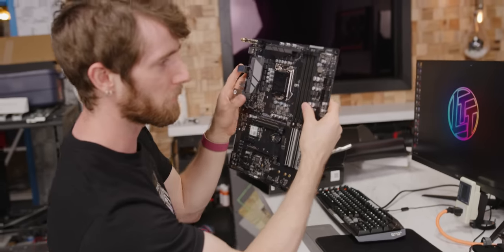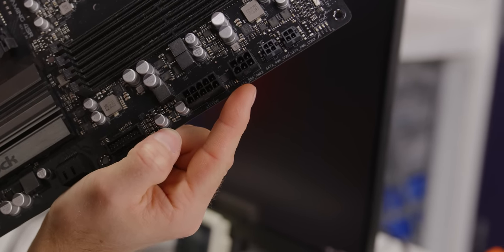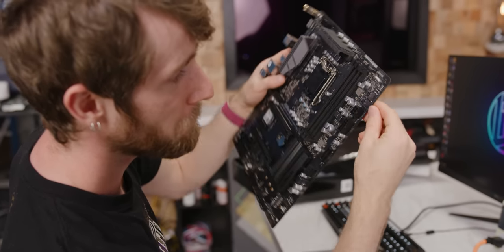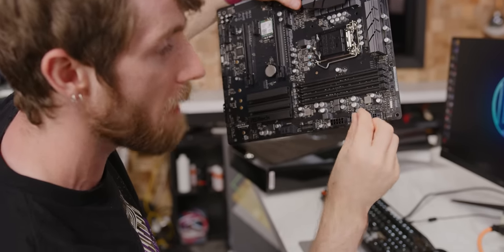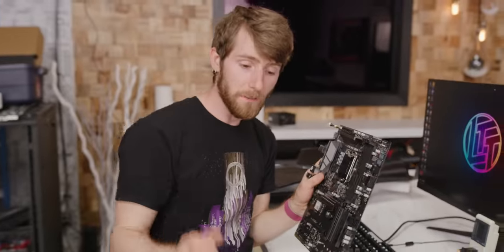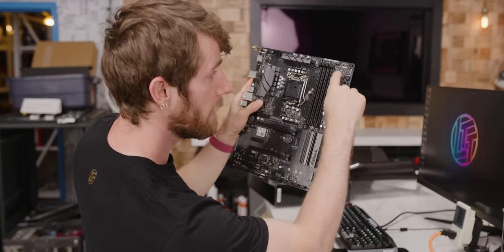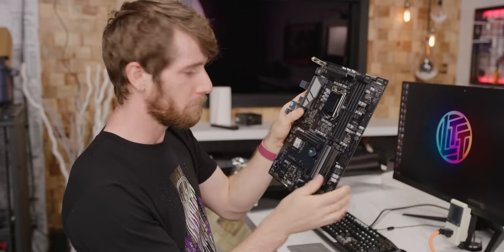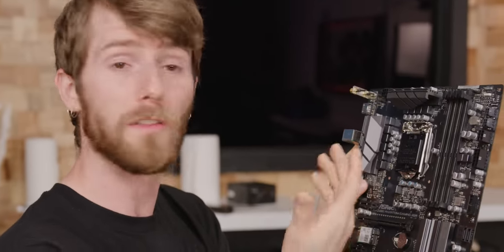But up here, this is where things get spicy. That's where that 10-pin connector goes — this is called the ATX 12VO connector. And then that second six-pin, which is otherwise identical to PCI Express six-pin, is apparently called ATX Board Power 2. These are fascinating: just like we saw on the Mac Pro where if you wanted to plug in a SATA drive you actually had to plug off of the motherboard to deliver power to it — we're seeing exactly the same thing here. These are SATA power connectors one and two. Remember, the SATA power connector on the power supply doesn't have all the conductors. So we actually need to take 12-volt into the motherboard, use this DC-to-DC conversion circuitry, and then come out here in order to properly power a SATA drive.